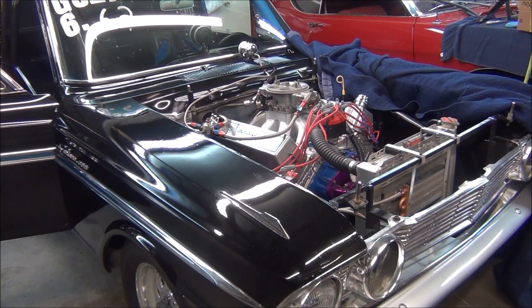So we're going to start it up and see if it'll run like I adjusted it. And if it don't idle right, we'll try to get it to idle using only the air fuel mixture screws and not screw around with that throttle plate adjustment. And we're going to check our float level. I just checked it after turning the pump on. It was a little high. Turned it down. But it needs to be running to get that right. So let's see what it does.